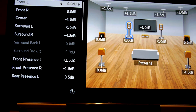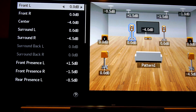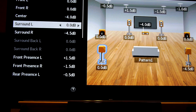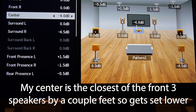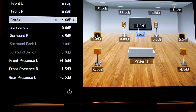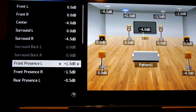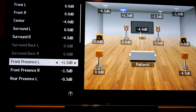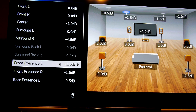What you want to do is play that test tone at the listening position of your choice. If your receiver has multiple presets, you could set two, go through them one at a time, and manually check to make sure everything is set to give you the same reading. That's a good base level, but there is preference. For example, if your dialogue is a little hard to hear, if you don't have a really high quality center, or if it's on the small side and not matching your speakers, feel free to bump that center up just one dB — that can make all the difference. Same with your height speakers: if your Atmos effects just aren't cutting it, bump them all up one dB evenly and see what kind of effect it has. One dB makes a big enough difference — certainly center to mains — to be noticeable. They don't all have to match, but it's good to know how far off you are, even if your AVR has automatic room correction.